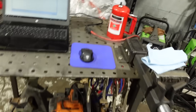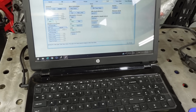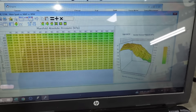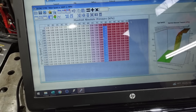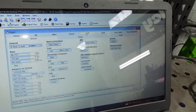Other than correcting the speedometer — which is now spot on — a few other things we'll do. In the spark table, we'll add a little bit of spark timing to get a little more power. At my altitude, we only get to the 80 kPa row under full throttle, so we added four and a half degrees more of timing. We'll do some data logging to see if that's enough or too much. I also leaned it out just a tiny bit under wide open throttle, because under power enrichment mode the stock tunes on these things are pretty rich.